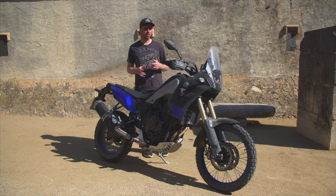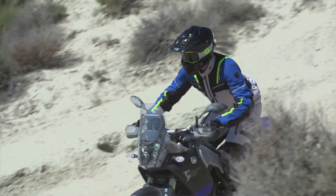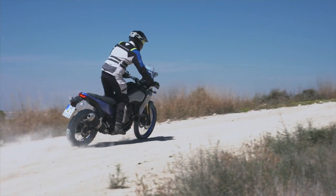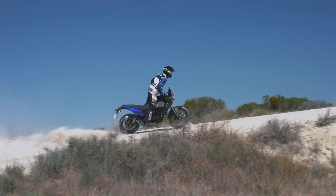Lastly, with the engine off-road: it doesn't have a lumpiness to the bottom end that a lot of the new generation of middleweight bikes have had. When you're sub-3000 RPM, it's super happy — happy like not many bikes are. As an off-road guy, I really enjoyed that because it made my life easy. It means it's really easy to get the front wheel up and over things, really easy to find grip on slippery uphills. It's just a brilliantly tuned engine for its purpose.